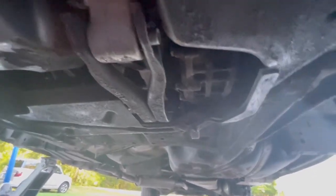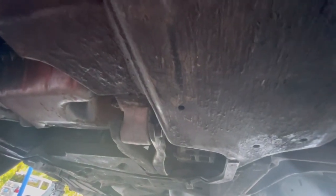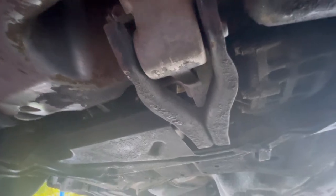When you go to put your protective plate back on, as soon as you get the back legs in, push the pan all the way back and you'll be able to do the latch up front, then start bolting it in. I would recommend starting with at least one of the front bolts to keep the pan from falling on you, then move to the back — you'll have to lift this up in order to get those studs to line up.